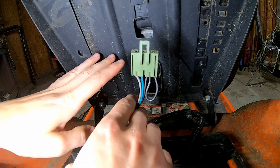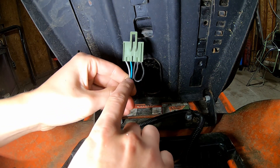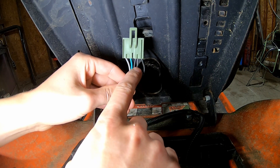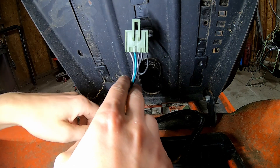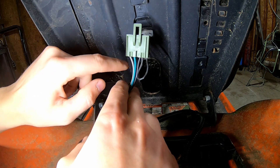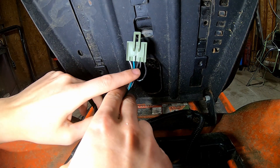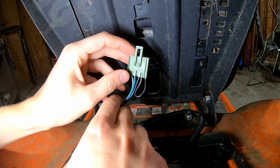In order to bypass this switch, you don't want either the left two wires to be grounded. So you could theoretically cut all these wires off and you'd be fine. You don't want any of these wires to be connected to ground. So you might think you could just pull this switch out and they should no longer be connected. Well, the engineers that designed this had another trick up their sleeve — when you pull this connector out, there's actually a wedge here on the switch itself that depresses a shorting bar inside.